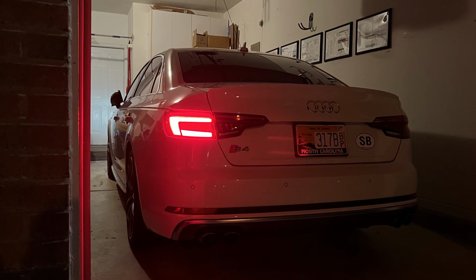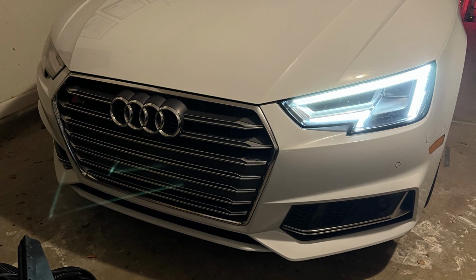Another thing, which you just saw in that clip as well, is I changed the comfort indicator, the little thing where you hit the turn signal once and it just flashes a couple times for a lane change. I changed that from 3 to 4. I also added the ability to do Euro-style parking lights, which is basically just where the parking lights only light up on one side of the car or the other. It's something I'm probably never actually going to use because I don't often find myself parallel parked at night, but it's still a fun thing to be able to do, and certainly confuses people.